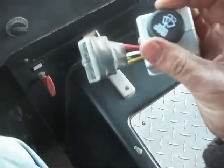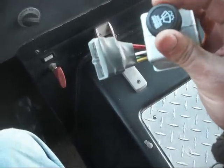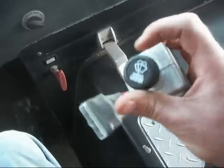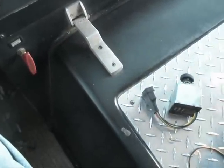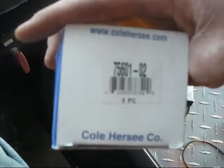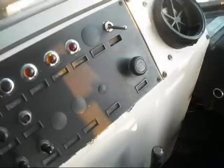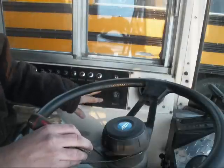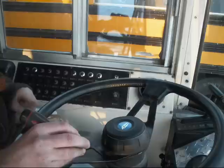There's on, all those are the positions for delay, and then high, and then all the way up there is the low. This is a Cole Hersey part — here's the part number for you. So we're going to go ahead and swap that out. First step is to disconnect the battery power anytime you're doing anything electrical.